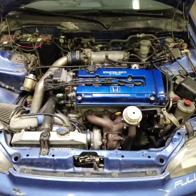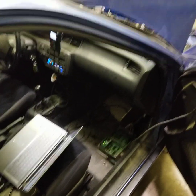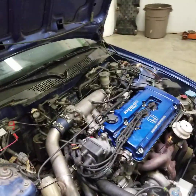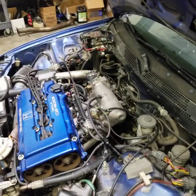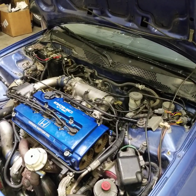That's something you guys should be aware of. A lot of people can take care of this stuff on their own. If it's got a bad TPS or a bad MAP sensor - let's say you have just one code for a bad MAP sensor - check the plugs to the MAP sensor first. If the plug's in good working order, no damaged wires, no frayed or pulled-out wires, chances are it's probably just going to be a bad MAP sensor. You can easily find stock MAP sensors for free or five to ten bucks, pop one on, and it's relatively easy to figure out if it's a sensor issue.